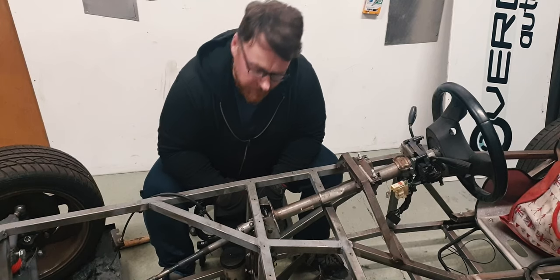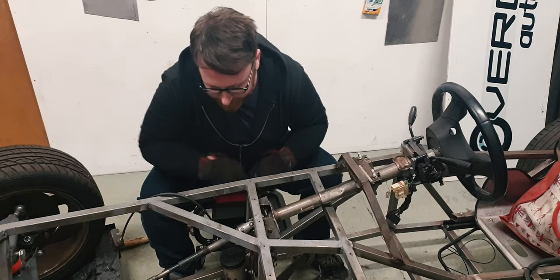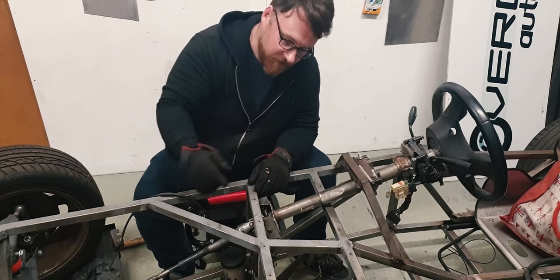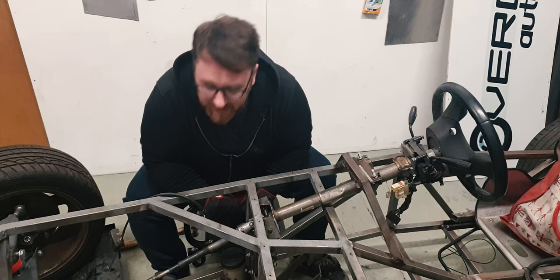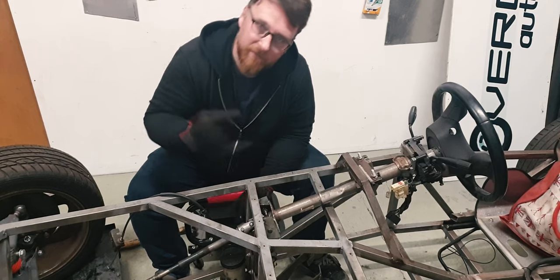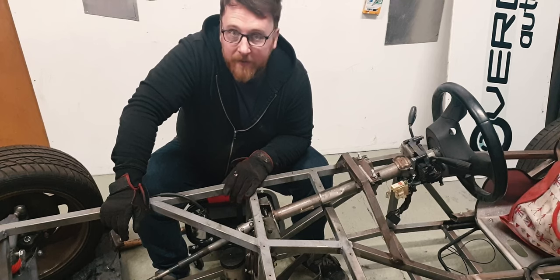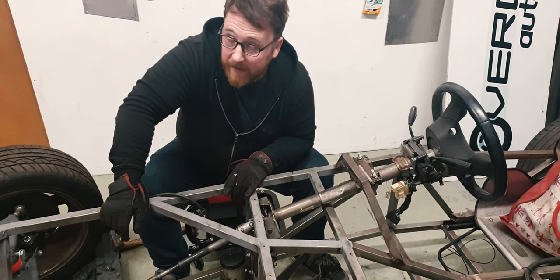So we gently alluded to this problem an episode ago maybe, that the engine sits here, by the way, and there's a clutch slave cylinder that pushes out and more or less pushes into where the bulkhead bottom is. I've kind of casually ignored this for a number of months because I kind of knew this would be a problem. I also knew that if I maybe just trimmed off the adjuster on it, I might actually get away without the actual arm hitting it. But what we've now established is the arm's going to hit it and then an inch beyond.